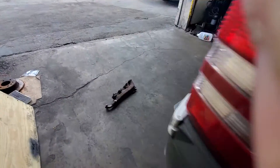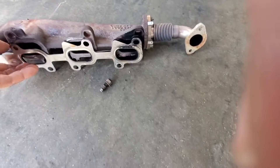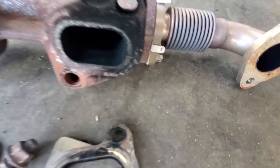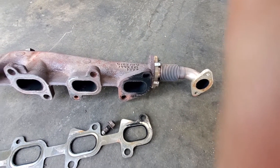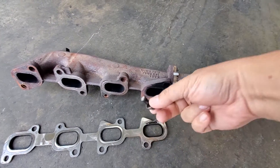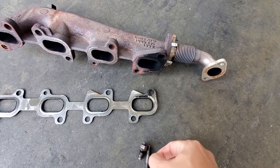Here's the bad boy — the second source of the whistle sound: the exhaust manifold. You can see something bad here. It's clean, clean, clean — oh, what's that? It's black. Basically that means exhaust at high RPMs was going out here. Here's the start — you see, it should be like this. And this is the new one.